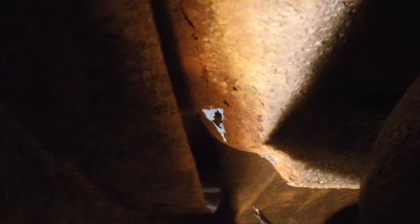You can see where the gas tank is in relation — you can see the light coming through the holes and the camera's up against the gas tank. There you can see the relation of the gas tank to those holes. So I'll just put a little piece of sheet metal in there, and I'll have to get a friend of mine to come over and lay here with my garden sprayer while I weld. So when that undercoating catches on fire, he can squirt it out. I can scrape most of it off with a putty knife but it's still going to need somebody to watch it while I do the welding.